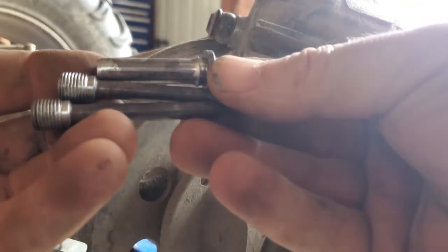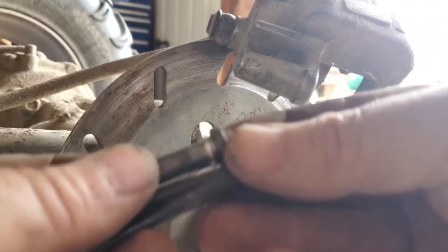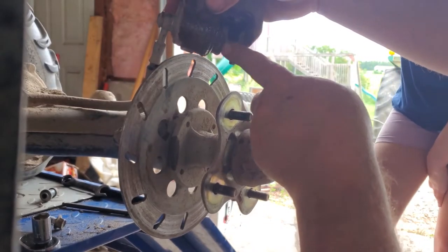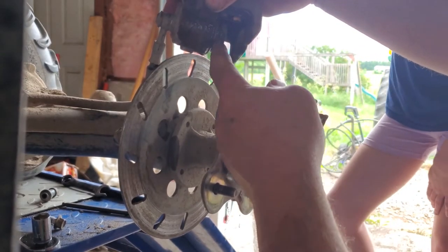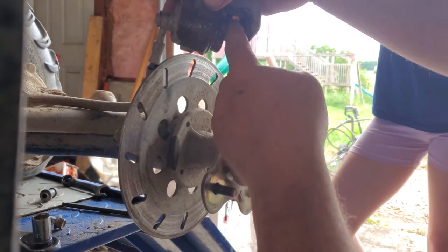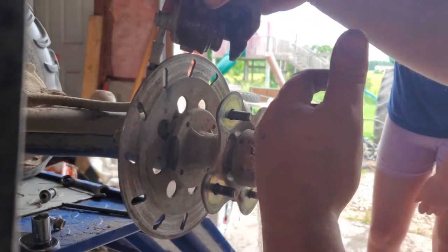Took the pins over to the wire wheel, cleaned them up - you can see 20 seconds and they look almost brand new. Before we can put this back in with the new brakes, we've got to push the piston back to make room. As your brakes wear, the piston stays out farther and farther so that when you touch the brakes they're there, instead of having to touch them and wait for the piston to move an inch.